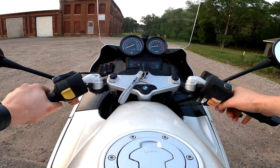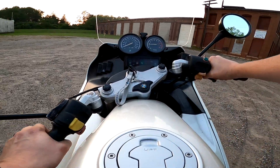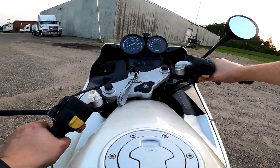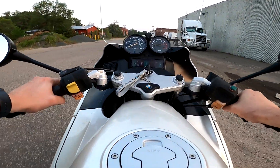What that's telling me is that we need a new battery, because our battery must have a dead cell and can't supply the bike with enough voltage to power the ABS pump and start the bike at the same time.